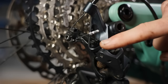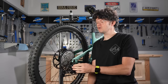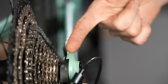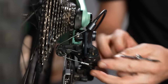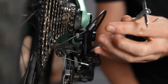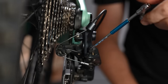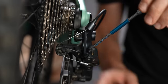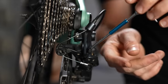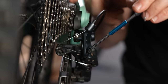Next, we're going to check and adjust the rear mech limit screws. The rear mech has a pair of limit screws to limit the range of motion of the rear mech. This stops the rear mech either throwing the chain off into the spokes if the upper limit's not correct, or wedging it between the frame if the lower limit screw is not in the right place. All rear mechs have got two limit screws, often labeled as high or low, or high position or low position, but you don't need to worry about that. Put the allen key in, turn it round, and with no tension on the rear mech as we've got now — this screw is setting the jockey wheel in the lowest position, setting the range of motion limit at the lowest point. As I screw in, it's reducing that range of motion and setting the position of the jockey wheel in alignment with that sprocket.